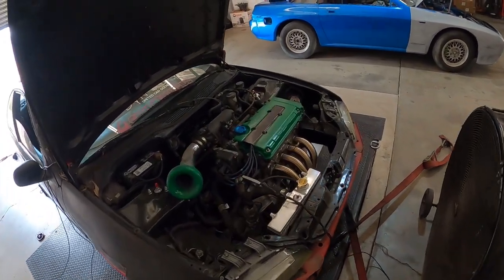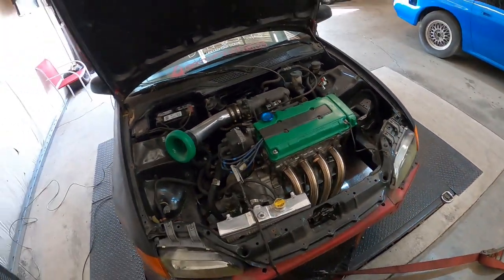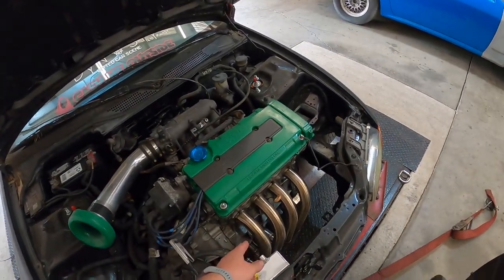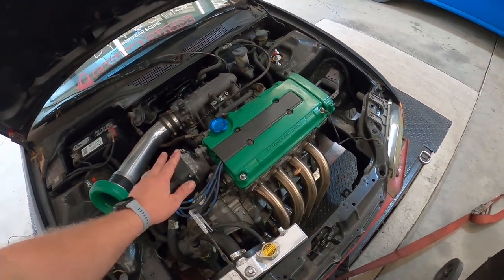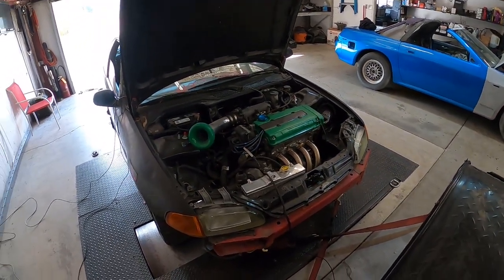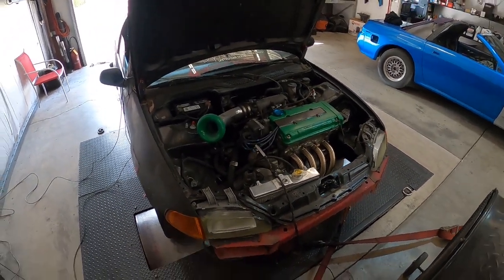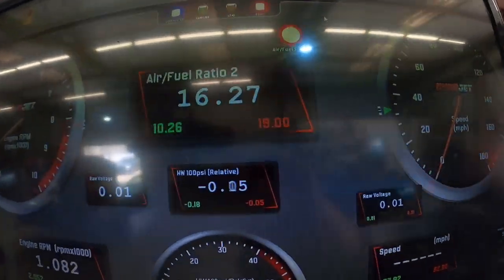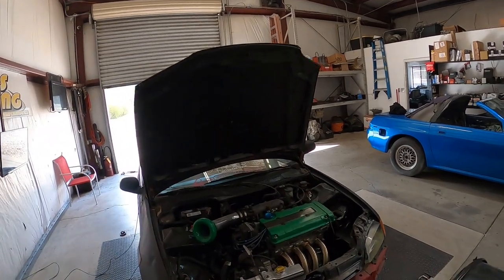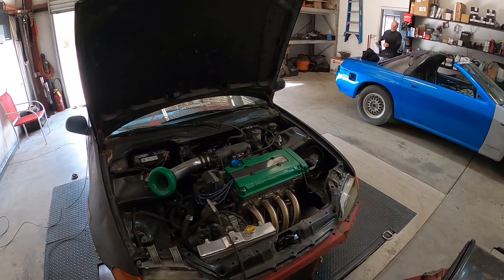While the temp gauge works on coming up — Dale's back with the B16 A2 Civic. We tuned this thing in 2020 with a different header on it. Jack Spania Racing has supplied them with this one. We've installed it and hooked it up to the exhaust. This first pull will just be a baseline on the chip the car's been running on. It's idling pretty lean — there are the air fuels. Hopefully the air fuels are good enough to take her to redline to see where she stands right now before we put any tuning improvement in it.